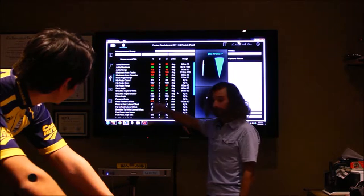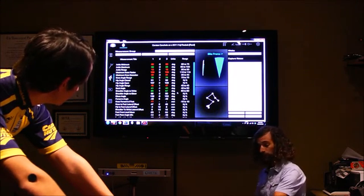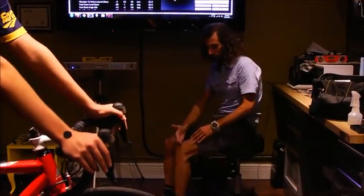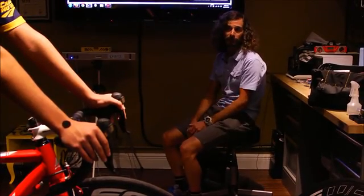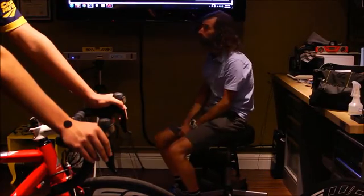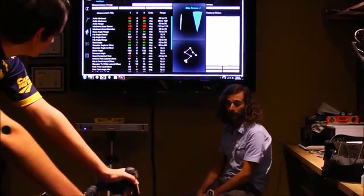If you come down here to knee forward a foot, that's sort of like the plumb bob type measurement. Normally the axis of rotation of your knee should be over your metatarsals to within about a centimeter. You're actually showing about 11 millimeters back — it's primarily a function of the seat being too high. As we lower the seat, it's going to bring your knee forward relative to your foot, so you may not need to move your seat forward necessarily, but we'll see what happens after we lower your seat.